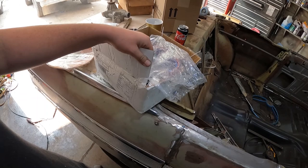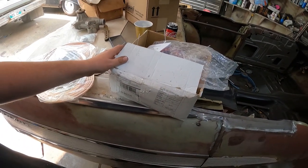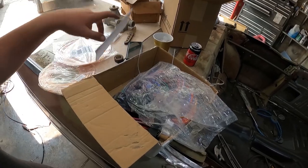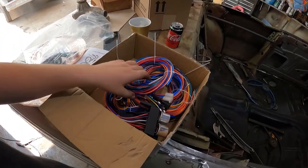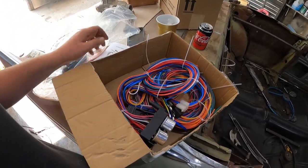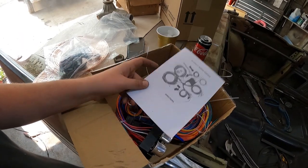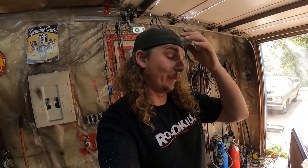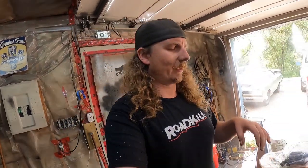I got this wiring harness — Frankie pre-opened it. Straight from China. I don't even know what brand this is. I don't like spending money on cheap stuff, but I got this one from Amazon China. It was $100. We'll see if it's any good or not. It's definitely different. There's no name or nothing, just directions. I didn't get the absolute cheapest one — there was one that was $60, but I read the reviews and the wires were not labeled, and they were only 6 or 8 feet long. Everyone was complaining that you'd get the start of it and then have to re-lengthen all the wires to the taillights, fuel sender, and front end.